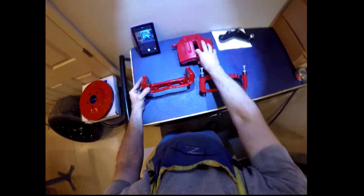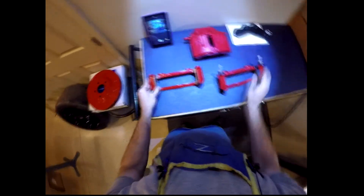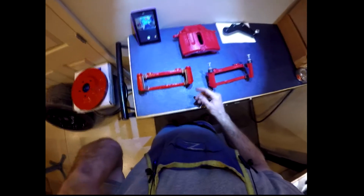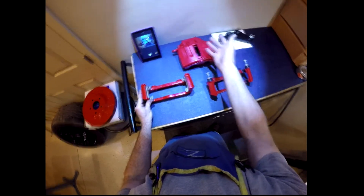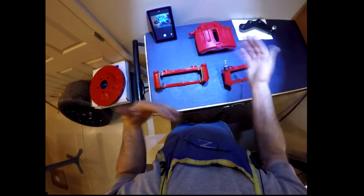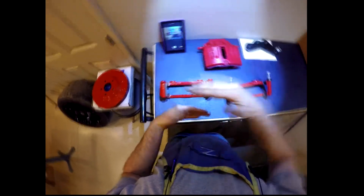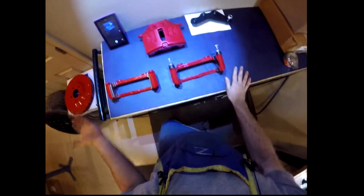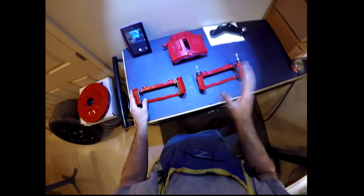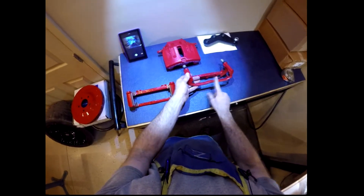Even with the standard setup, if you have the later model C4 Corvettes with the saw blade rims, you still won't be able to run the C5/C6 conversion. There's an inner lip or some clearance issue from top to bottom that I've read about. I didn't have those rims so I put on aftermarkets — just be aware if you have that car and you're thinking about doing this, you're going to have to come up with a different rim. Again, you need an 18 inch rim to run the heavy duty setup.